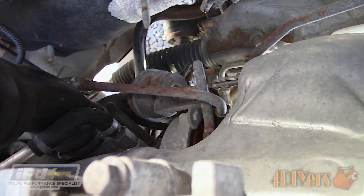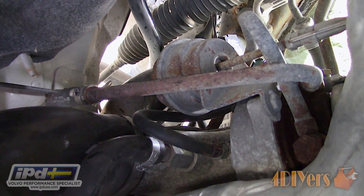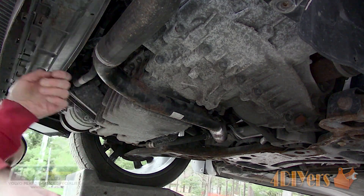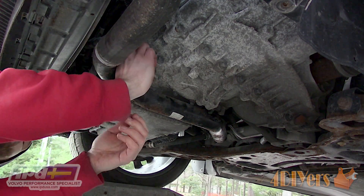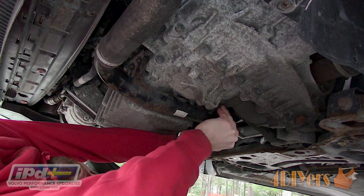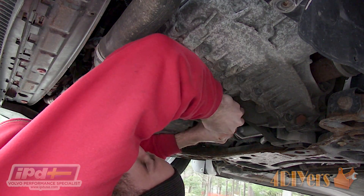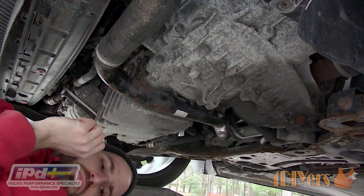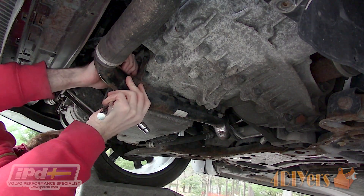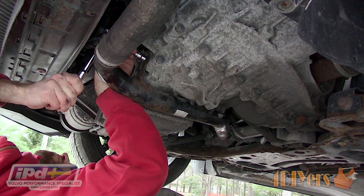Here is a reference clip on top of the turbo. You can see the actuator and the intake tube vacuum line which is used for fitting number 3. Reinstall the rubber connection onto the turbo and tighten the upper gear clamp. Install the lower charge pipe into both the rubber fittings, ensure it is fitted correctly, then tighten the clamps. The clamps can also be tightened after the pipe is bolted in place if you wish. Now install the bolts onto the transmission and oil pan. Considering these bolts are going into aluminum, a medium grade thread locker can be used to help prevent the bolts from seizing. Then tighten the bolts.